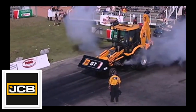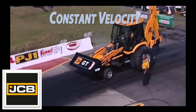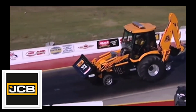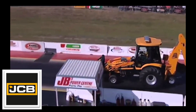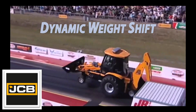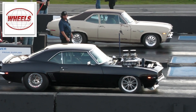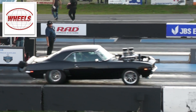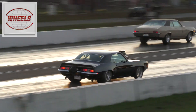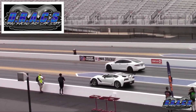No acceleration, no anti-squat possible. Here are some real-life examples. Here are some older cars with unknown or questionable anti-squat — notice how the front wheel lifts under acceleration. Here are some newer cars where the anti-squat response has almost certainly been designed into the car. Notice how the chassis stays level.